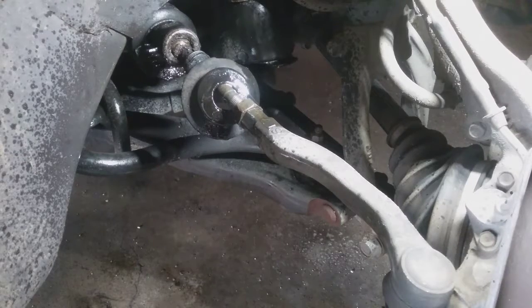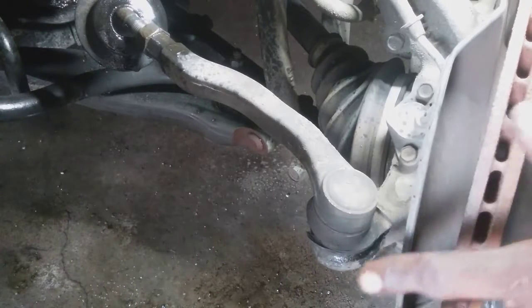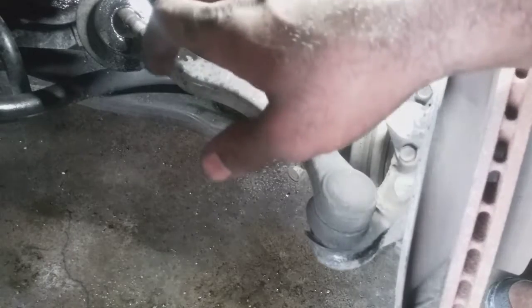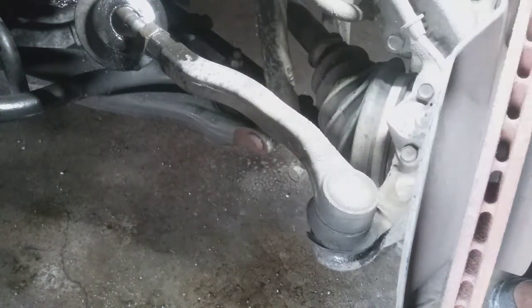Clean it off just to make it greasy again. Alright, first we're going to use a 17 to knock the outer tie rod off the bottom. I'm going to replace it, then get measurements and count the threads, and we can start proceeding with removing the bellow, and I will take my special tool out to get the inner tie rod.